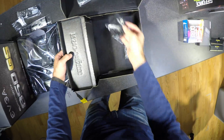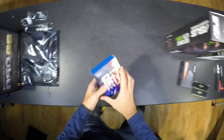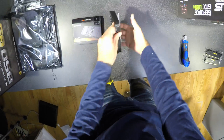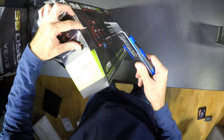Put aside packaging and the rest. If you are not sure what you need, then I recommend reading the manual first or watching this video. From the motherboard box, I will need only the back plate, SATA cable and screws for the M.2 drive. I'm keeping the CPU in the plastic case until I actually need it.